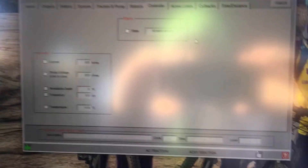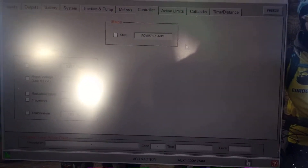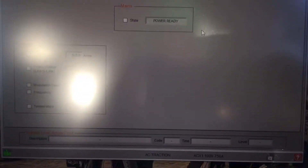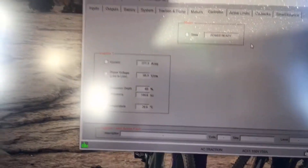I'm about to turn onto a highway where the speed limit is 50 miles per hour — it's a nice straight flat section here, looks like no traffic right now. So we'll go ahead and take her up to 50. You may have heard a little vibration — this motor has a torque flutter that occurs from a stop, and as soon as you get past just a few hundred RPM you don't notice it at all anymore, it's just butter smooth. There's 30 miles an hour, still accelerating. This is real mild acceleration, not quite 50% throttle. There's 50 miles per hour, so I'm going to back out of the throttle. In warm weather it was pulling about 140 amps at 50 miles per hour, but knowing that it's cold and we've got the hubs locked, it's looking like we're well over 200 amps at 50 miles per hour. The difference in weather and the difference in driveline efficiency is a real thing — it makes a big difference in how electric vehicles operate.